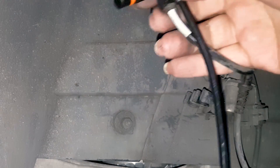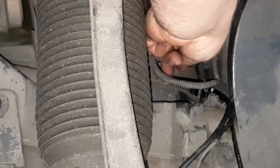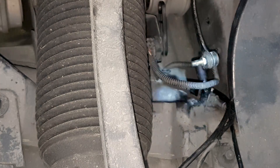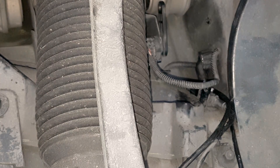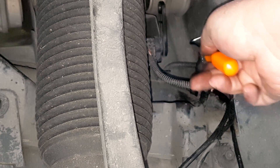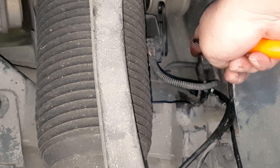You couple the new sensor with the automatic suspension sensor, then press it up and it goes all the way in. You can take a photo first to see how far it should go, because it might stop due to all those cables. You may have to pry some of those cables out or under in order to get it to fully seat.